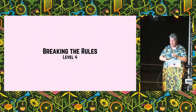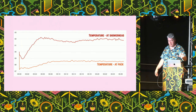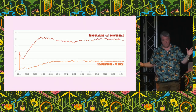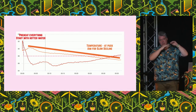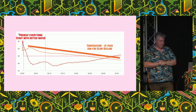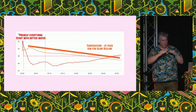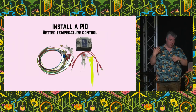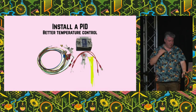Now let's start talking about breaking the rules and breaking free from that standard. Remember we talked about temperature — what actually makes the best tasting espresso is if you decrease the temperature over time: start with water as hot as possible in the brew chamber, but then by decreasing it you stop that harshness coming at the end. If you can find a way to get hot water right at the beginning and then slowly cool the water throughout the course of the brew, and preheat all components, you can also install an aftermarket PID to help your machine get much more temperature stability.